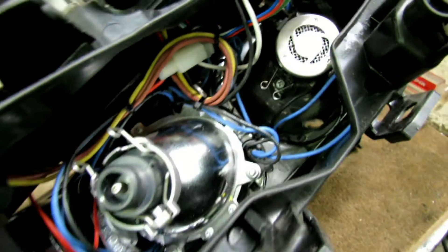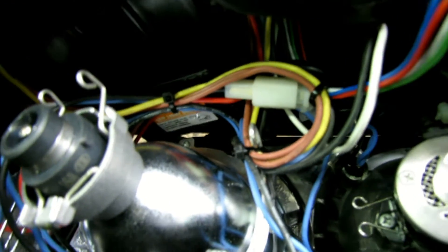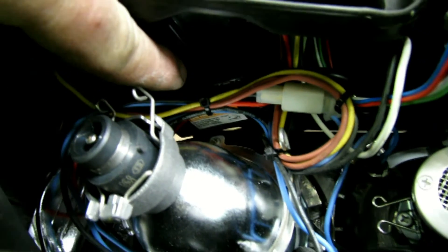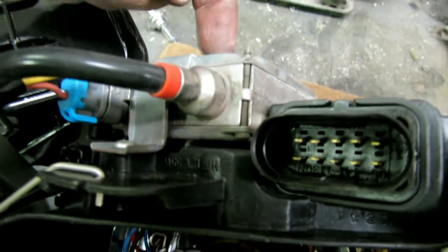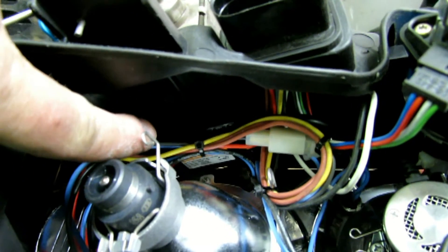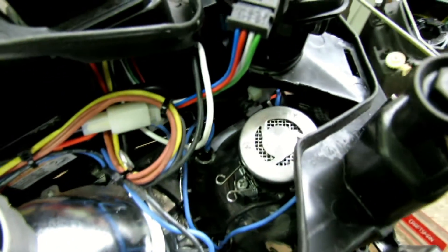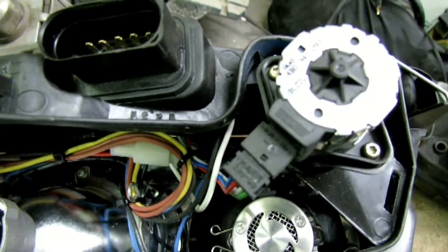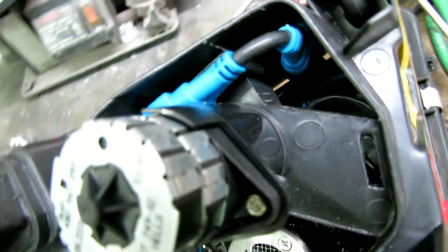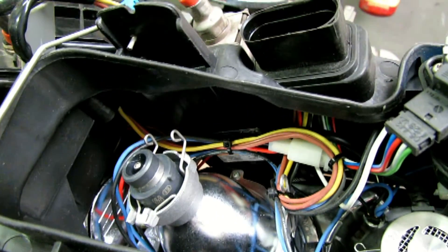I've gone ahead and installed the LED lamp. As if there weren't enough wires already, we added an LED driver. There's a nice flat spot on the opposite side of the plastic from the HID ballast, so the LED driver power supply is double-sided taped to the bottom of the headlight on the inside. I routed the wires where they wouldn't interfere with headlight movement — about a foot of extra wire between the adapters — and zip tied everything in place.